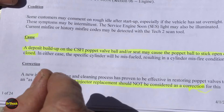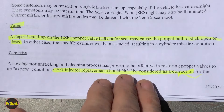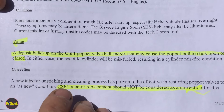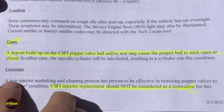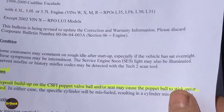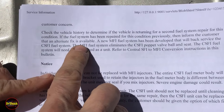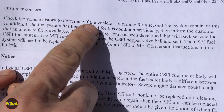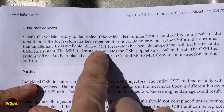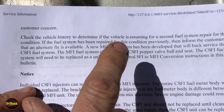Carbon deposits cause the poppet valves at the end of the injectors to either get stuck open or stuck closed, causing a variety of problems. Dealers were told not to replace the injectors — instead they use a special cleaner from GM, GM's top engine cleaner, to bring them back to like-new operating condition. Since the problem was particularly problematic with certain fuels, if the cleaning didn't hold and you kept getting the same set of problems multiple times, GM would relent and give you an upgrade to MFI.